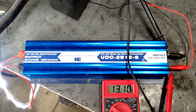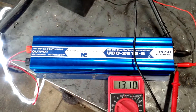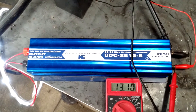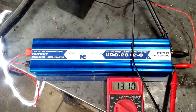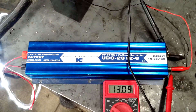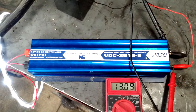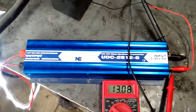How I fight this with the existing electronics — some of the more sensitive electronics that I have in the RV — is with this buck boost. Newer charge controllers would deliver the higher voltage needed to charge the battery, but then deliver a consistent 12 volts to the actual devices in the RV. They kind of have two circuits inside: one charges the battery, one powers the RV while the battery is charging. Back in the 70s, some of the chargers didn't work that way, and mine is a perfect example of that.